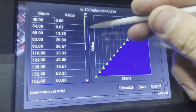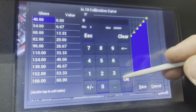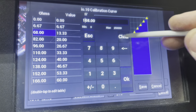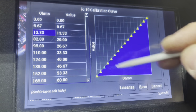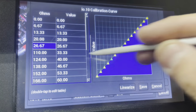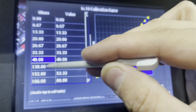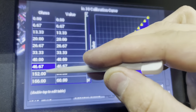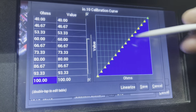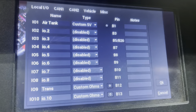If you look at the ohm value though, these do not line up. We needed 0 to 100 ohms from our testing earlier. When you double-click it'll let you manually put in whatever values you need into this table. The ohms reading needs to line up to whatever your sensor — in this case the fuel level sending unit — value was, and then the value column is what your number on the dash is going to be. Once you're done it's good practice to go back and make sure your table is correct. After that hit save and it'll go back to your main menu.